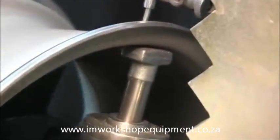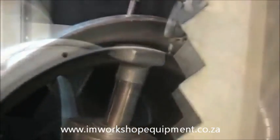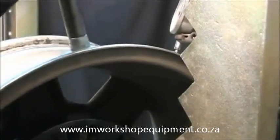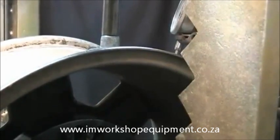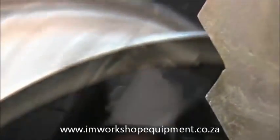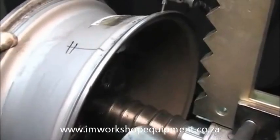Once you've achieved the corrections on the rim's low damaged areas, you're now ready to begin correcting the high spots that we've previously marked. Because of the unique design of the Blansmatic overhead push point bar, you will be able to achieve any angle in the reshaping process. Once again, because of the attachment selections, you are able to utilize a variety of actuator extensions during this stage.